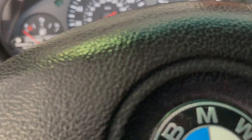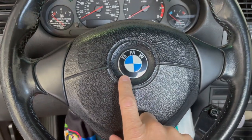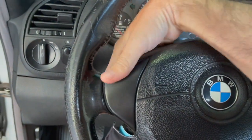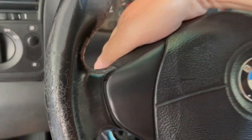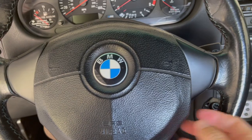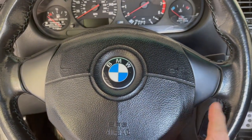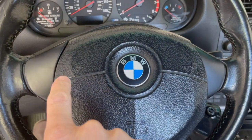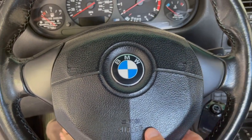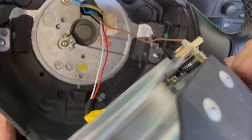You can try to maneuver the cluster out by turning the steering wheel left and right if you have the engine on, but it's easy enough to just remove the steering wheel. Use a T27 — the screws are right here in the back, you can feel them. It helps if the steering wheel is turned a little bit, but there's enough play to get in there. Note: since you're turned around, you may accidentally tighten instead of loosen, so pay attention to direction.